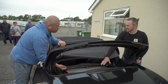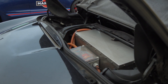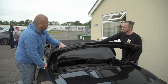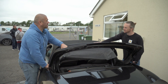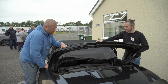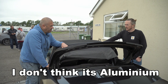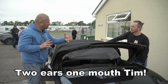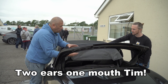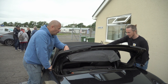What's the battery box made of? Stainless steel. A lot of people use mild steel or aluminium — alley is good from a weight point of view. We did it in stainless because it's out in the elements and we had access to the material. They're not going to rust, we don't have to paint them, they just go straight in. And if it's designed right, the structure will be strong enough — so we just did it in stainless, it's a nicer touch.